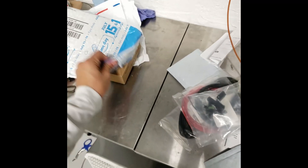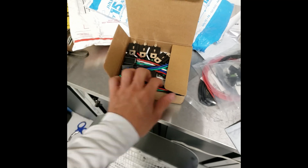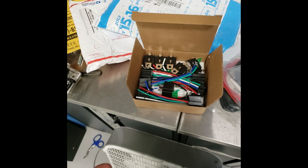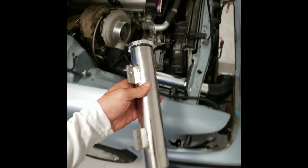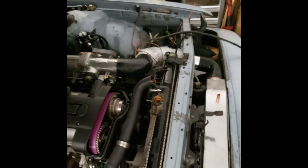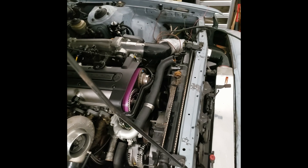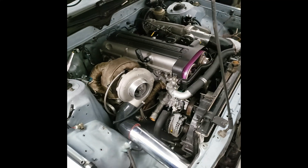From Amazon, it's a relay kit. I needed some relays to wire in the fans. I'm having trouble finding the right kind, so I bought these cheap ones off Amazon - if they burn out, I'll research replacements. Also, I got ahold of the fabricator. He said he'll let me know next week when he has some free time - I need him to mount the overflow can, mount the catch can somewhere in the back corner, fit the intercooler pipe better, and weld on the blow-off valve and IAT sensor. Maybe have him weld up the stock twin feed as well.